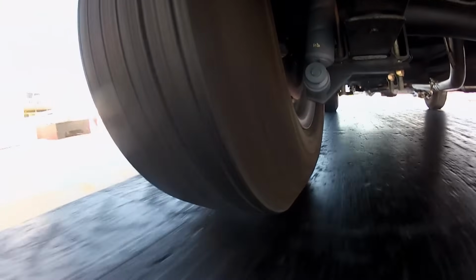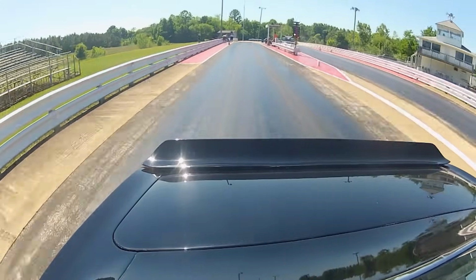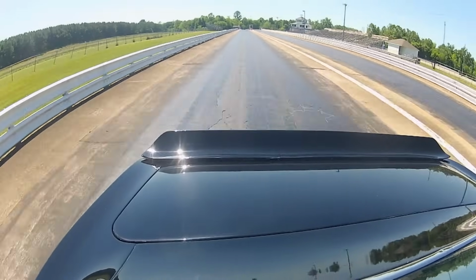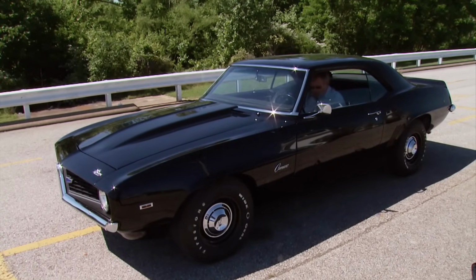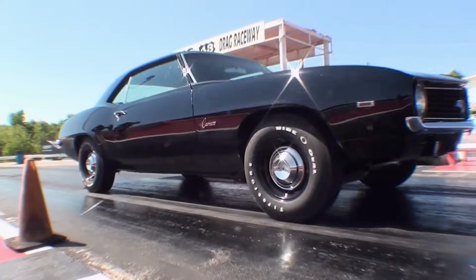You may notice that she's pretty tricky coming out of the hole. Those bias-plies are being pushed to their limit for sure. We brought the air in the tires down from 34 pounds to 28. Mank jumped in for a run. Lo and behold, my feel for it was a little hot for the first run, and I probably pushed it too hard, missing a shift.